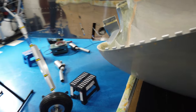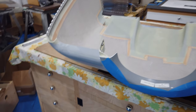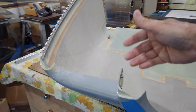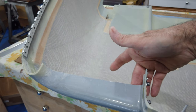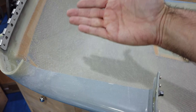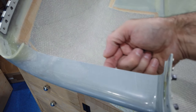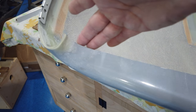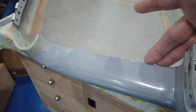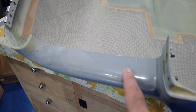Basically what they're talking about is that metal strip has to fit up underneath here and then your rubber is going to stick out this way. This is the bottom cowling as it would be mounted to the airplane. The metal strip gets put under here, shaped to the inlet, and sandwiched between that and the cowling will be your piece of rubber that sticks out. This surface underneath here needs to be somewhat smooth and flat so you can have something nice to attach those to. The front edge of that strip is even with the edge of the cowling.